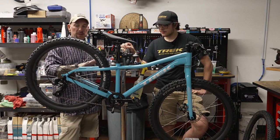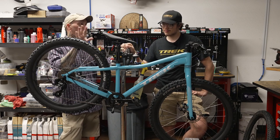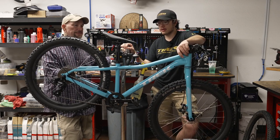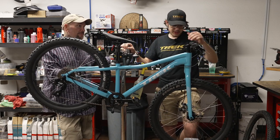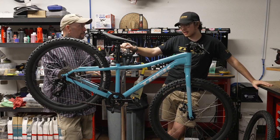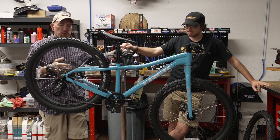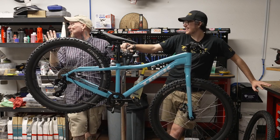Is there any upgradability on this bike? Can you do a dropper post — I know they make a 60mm dropper post now — or upgrade the derailleur? Shimano makes a lot of seven to eight speed stuff, so there's definitely some upgradability there. You could technically put a hydraulic brake on it — no issue with that. It's not going to go tubeless unfortunately, and a dropper post won't quite work in there; you'd be hard pressed to get that to work properly.